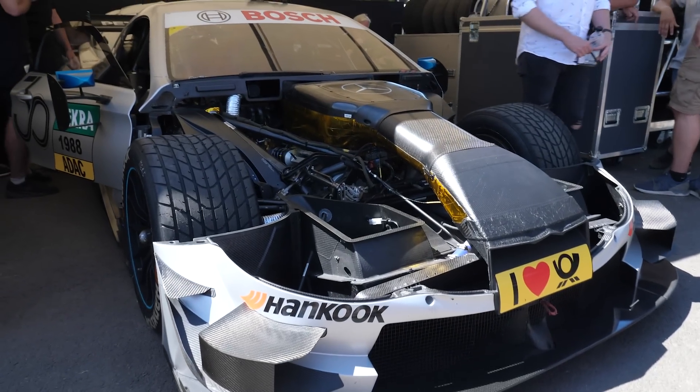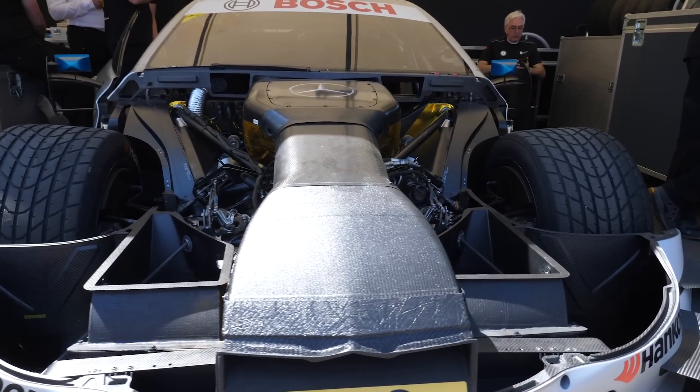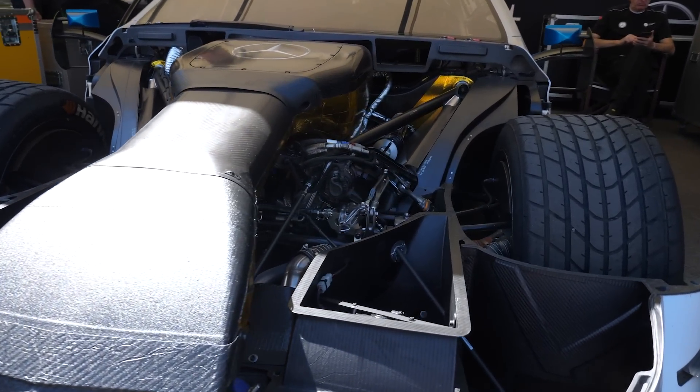It's one thing to get the air ducted to the radiator, but when it goes through the radiator it's got to get out the other side. Ducting out the rear side of the radiator is important because if you just allow the air to flow loosely into the engine bay, it's going to be lazy, not find its way out, and create a high pressure point behind the radiator, blocking airflow. Ducting out through the bonnet is the best way, as there's a large flat surface area to vent straight out the top. You can also vent through the wheel wells or the side of the car with good effect.